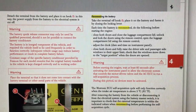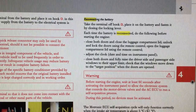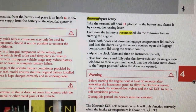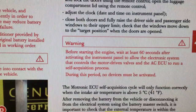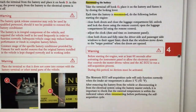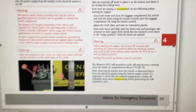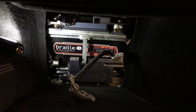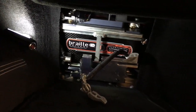Just a quick note before we wrap up: if you're not familiar with Ferraris, when you reconnect the battery you have to go through a few procedures. Open and close the doors and luggage compartment, raise the windows, set the clock, and most importantly before you start the car, give it about 60 seconds for the valves, motor-driven valves, and the ECU to sync up with the car. Make sure you refer to page 225 in the owner's manual when it comes to reconnecting the battery.